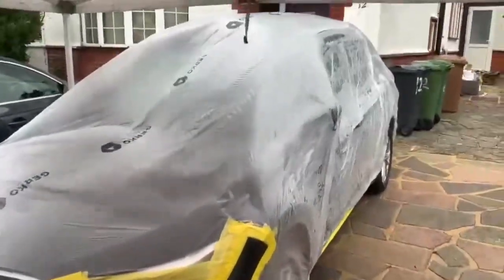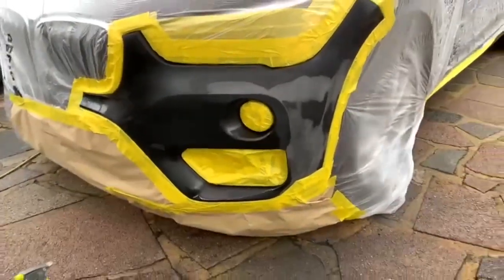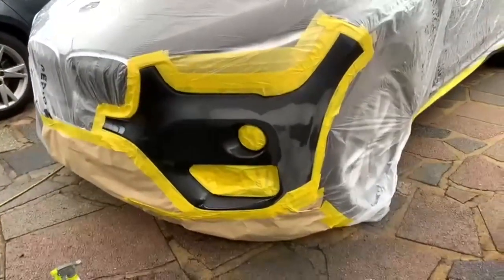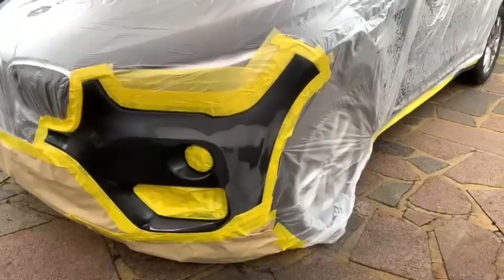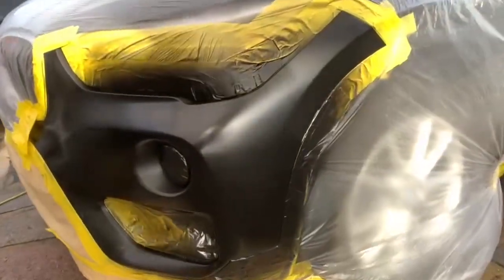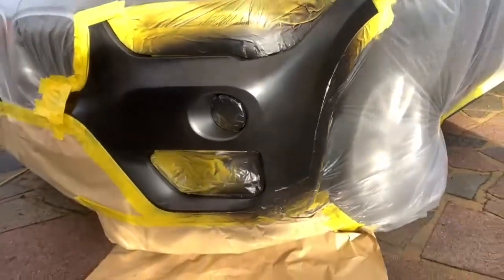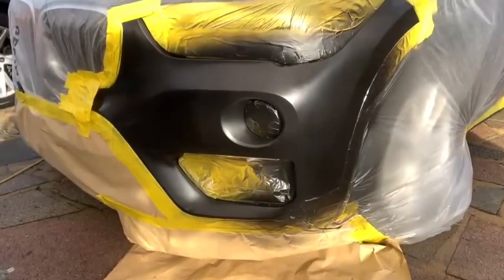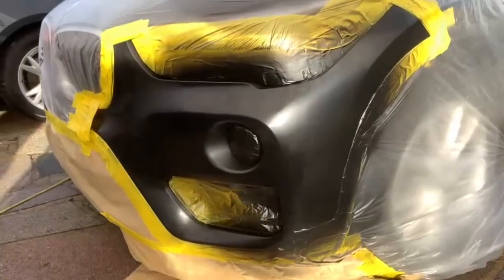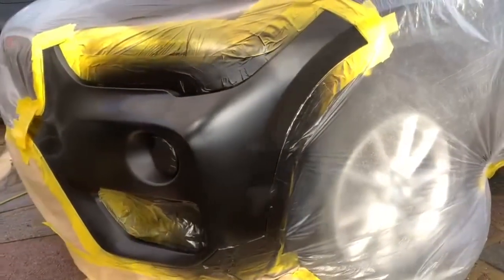Alright, so the car's all set up. The repair area has been masked, just a little bit of primer to go on, and then we'll get the paint application underway. Base coat has just been applied — that's the black, which you can see around the masking tape. Next is going to be the clear coat, which is the gloss that covers the black and makes the bumper nice and shiny, so keep watching for the application process.